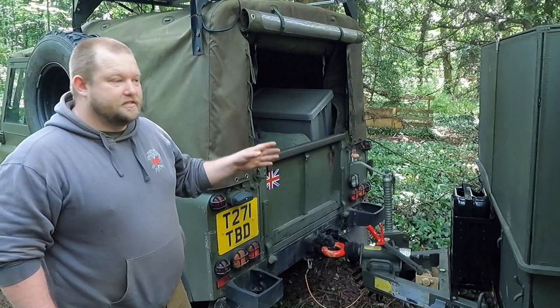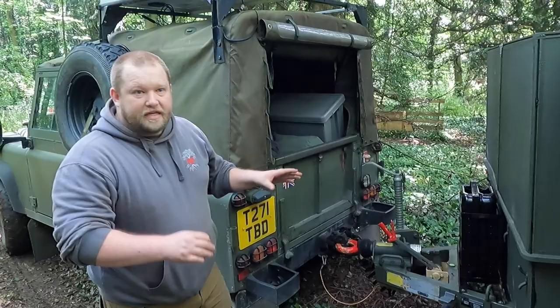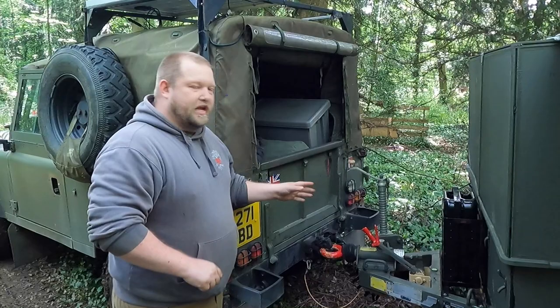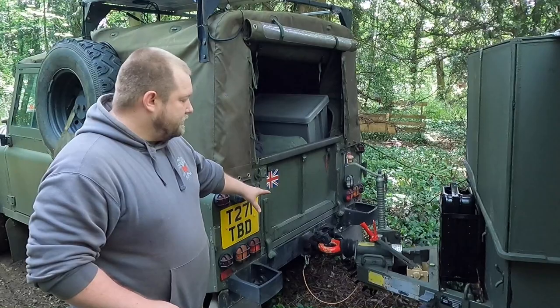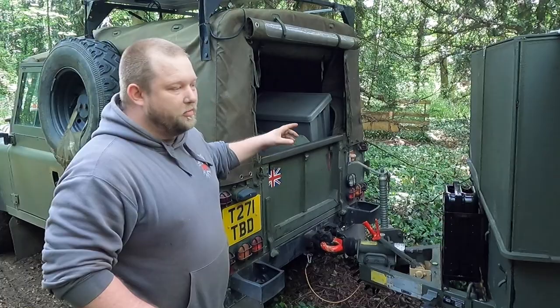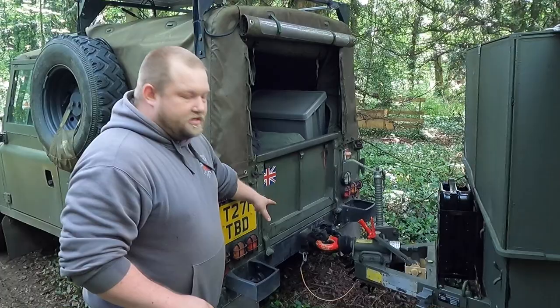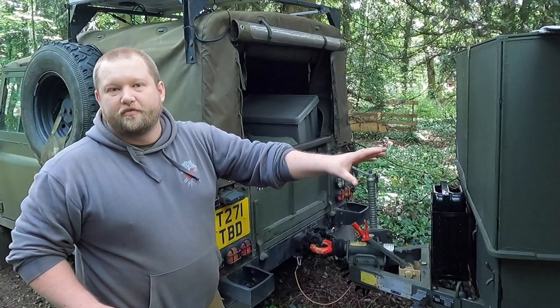From the back of the Wolf, British military uses the NATO hitch and NATO lunette ring for off-roading — it's the best option for the combination we've got. There are some Australian equivalents like Patriot Campers, but I don't quite see how they'd be any better than a lunette ring in this case. With the Sankey, the prime mover hitch has to rotate whereas on a Penman the trailer lunette ring rotates — that's the difference between the two. With it being 24-volt the electrics on the trailer side are 24-volt as well.